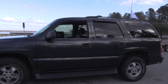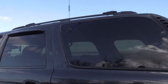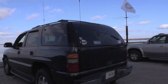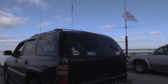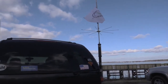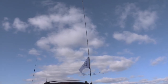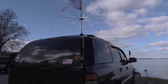It's a two-wheel drive, but I don't go many places that I need four-wheel drive, so that's fine. On the outside we've got a few antennas. I've got a two-meter 440 antenna on the window here that came on the truck when I bought it. I thought it was a cell phone antenna when I first got it, but I connected my antenna analyzer to it and it's 1.3 SWR on 440, so that's pretty good. I also have my Tar Heel 2 HF screwdriver antenna. When I'm doing activations, I have the MFJ 1979 17-foot whip on there, and I've got my Parks on the Air flag zip-tied to that so I can represent.